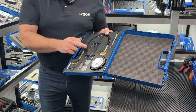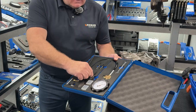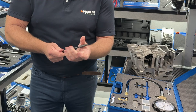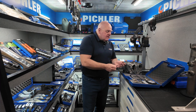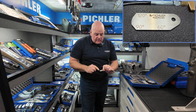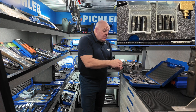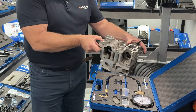It covers M8, M9, M10, and M10x1.25. You've got the long dummy glow plug body and then all the different guides. You select your gauge against the glow plug seat to determine whether it's 120, 90, or 60 degrees, then select the right adapter. There are two different sizes plus your seat angles — here I'm setting it up on a 1.6 DV6 engine that we've cut in half so we can check compressions.